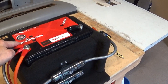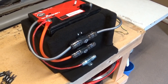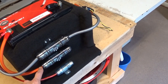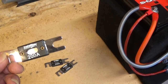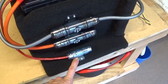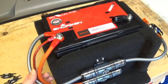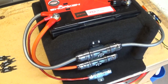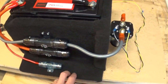The gray wires coming in so that our second battery is connected to the front and getting charged off the alternator while the car is being driven. The orange wire is running to our sub amp, fused - we use the large ANL fuses. I used a smaller one here for the four channel amp, it's only a 60 amp fuse with some little 8 gauge wire. I decided to do the power wires different so somebody after me would kind of see what's going on. So this is ready to be secured down in the trunk.